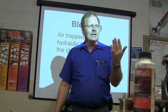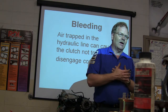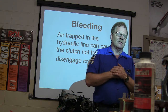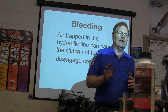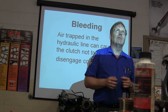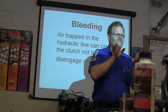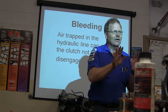If the clutch is too tight, that happens whenever it's worn — like this Dodge Stealth that had been bought for $400-$500, had jumped and bent valves, the engine was fixed but when driving it the clutch wouldn't release all the way. It was partially engaged. I went over there and it had a little clevis under there with a threaded rod and a nut, and I adjusted that and gave him a good clutch.